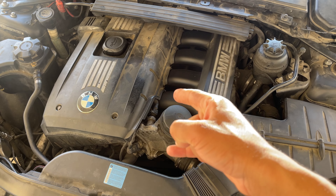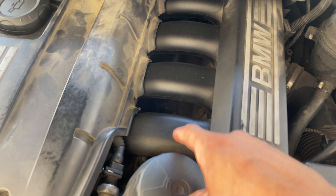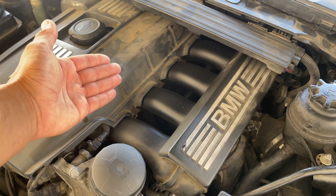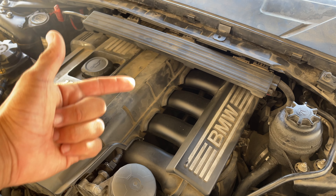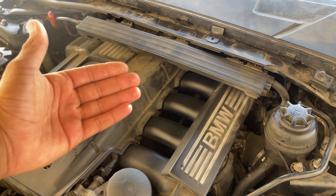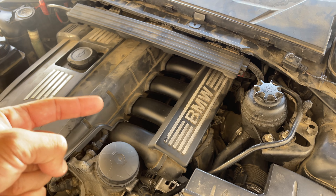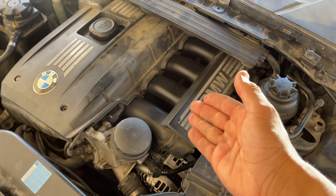What is going on guys? Welcome back to the channel. In today's video I'm going to be showing y'all how to replace the intake manifold gasket on your BMW E90, E92, or E93. There's actually a ton of different reasons why you're going to have to replace your intake manifold gasket on this vehicle — basically anytime you have to remove the intake manifold for maintenance such as replacing your starter, accessing your brake vacuum pump, or solving vacuum leaks. Last time I removed this I did not replace the gasket, so right now we're going to go ahead and remove it and swap out the gaskets.